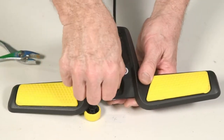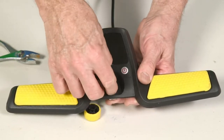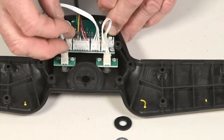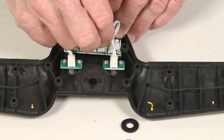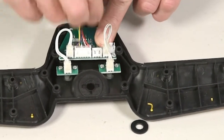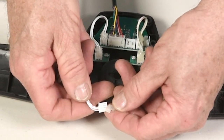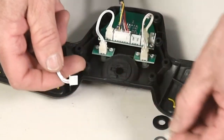You'll notice that in addition to the jam nut, there's a little washer in there as well to secure it in place. Once the rheostat is removed from the handle, disconnect the connector on the circuit board — pull straight out. Sometimes they attach a little gum rubber to secure it better, but there's no need to replace that; it fits in snug enough.